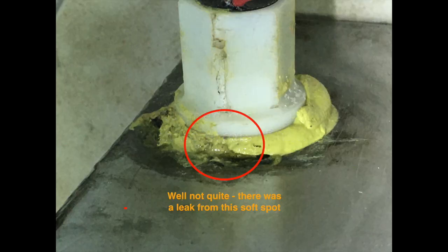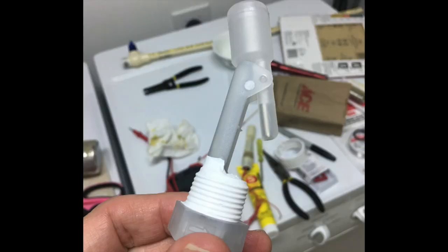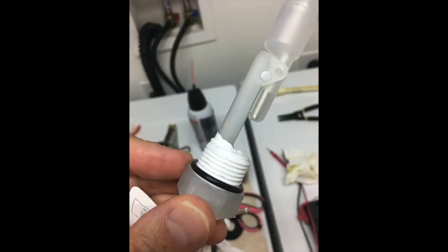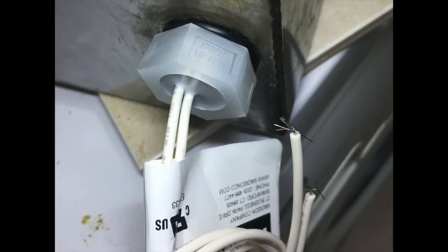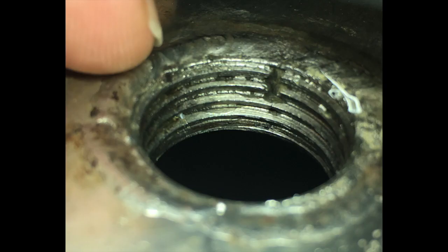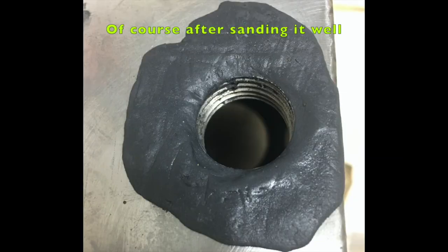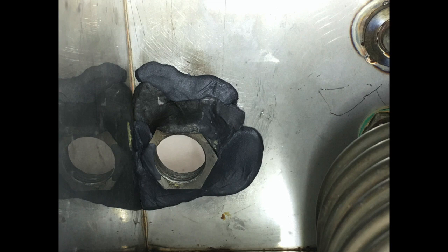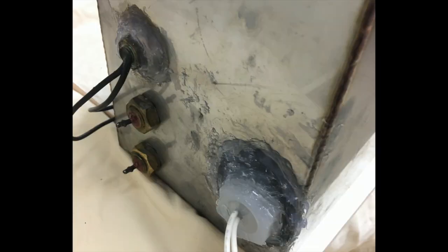The float switch threads leaked in several areas, so I got a new float switch and tried again. This time I only used Teflon tape and an o-ring, then threaded the float switch into the unit and tested for leaks by filling the tank — unfortunately it leaked. Upon close examination the female threads of the unit are corroded in both the front and the back. So I puttied the front really well and carved out new threads for it, reinforced the inside nut with more putty, then used Teflon tape, an o-ring, and pipe thread sealant. I inserted the float switch, tightened it, and reinforced the outside with silicone to make sure it doesn't leak.